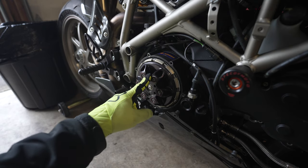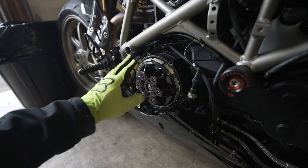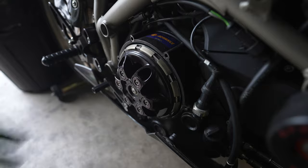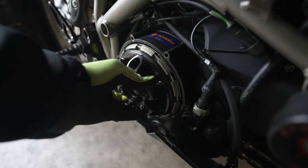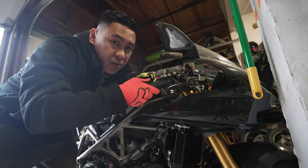This is what a dry clutch looks like. Inside your sport bike you may have a wet clutch, but they basically do the same thing. You see how tight this is? When the clutch lever gets pulled in, it loosens the clutch, which frees up everything in here. As you let go, everything tightens back up. Now you can't move it, and whatever gear you're in will be activated, and you can use the throttle to move the bike forward.